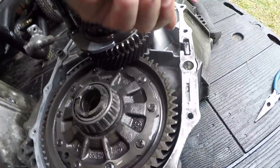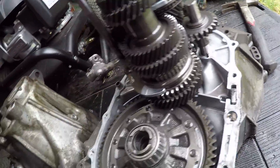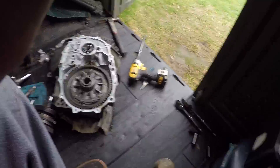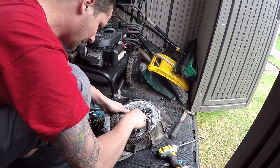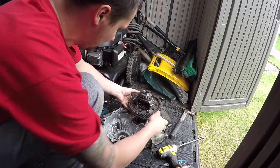This is it — that's how you remove it — it's all removed. Now I'll be inspecting the synchros and checking all the gears. Everything seems to be fine, however as you can see there are some metal shavings here, so I'll have to pull this and see if anything is completely broken. Here's where we have the diff — I'll be pulling these forks up, removing the diff, and working on it. After enough work doing this for the first time, we have a little mess but the good news is we have access to the diff. Let me pull this out — there's a bearing I don't want to lose.